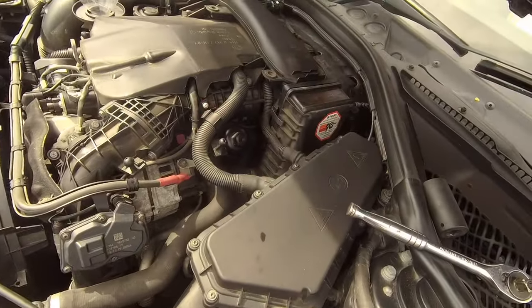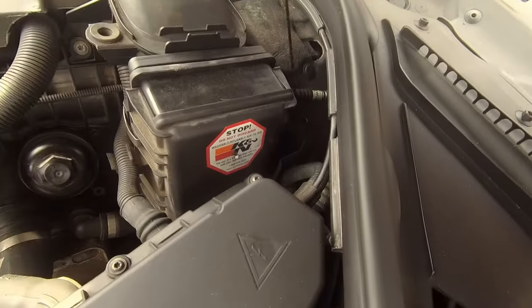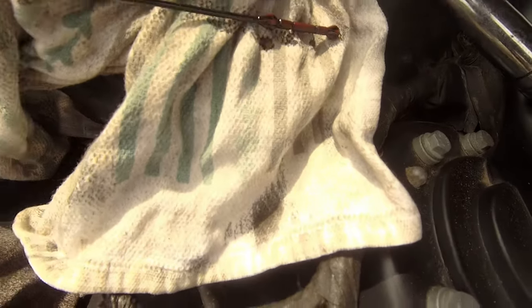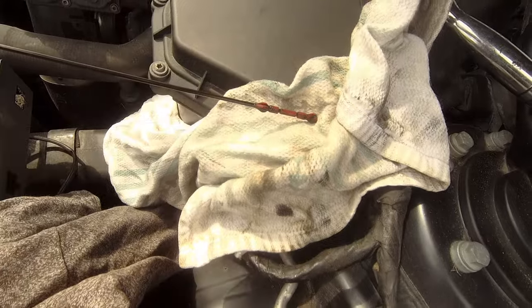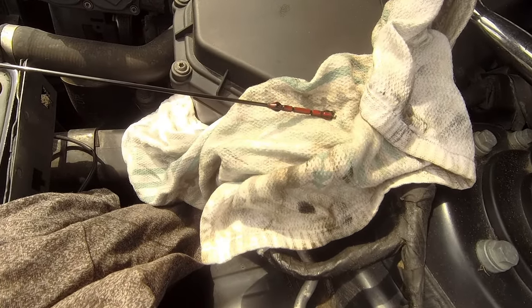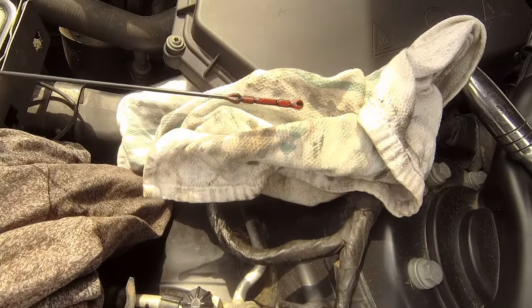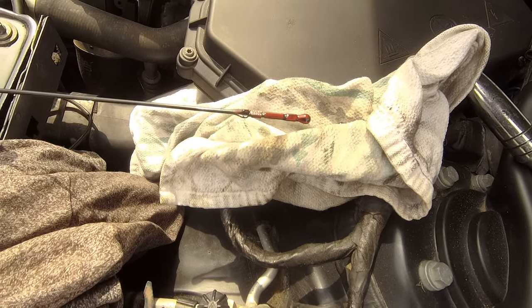Okay, that's another 3 in. So pull the dipstick now, have a look. Give it a clean. Clean it off. Yeah, you guessed it, 2 hands. That's dipped it, and as you can see, it's just touching the bottom. So, yeah, I need another litre at least, I think. Right, dipped again, and it looks like we're just touching before the maximum.